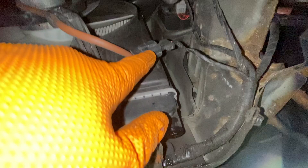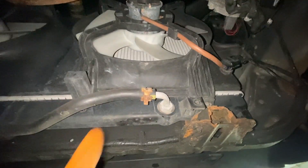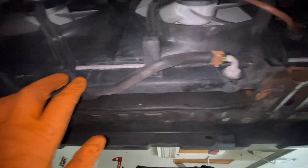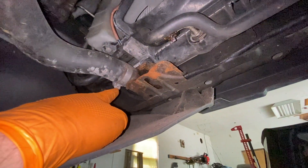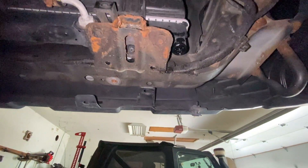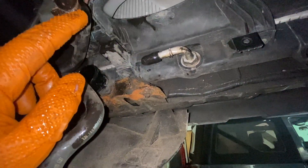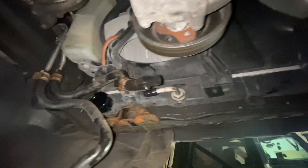After that, there's going to be a plug here for the fan — just disconnect this connector. You take that connector out, and over here you're going to have tranny lines, one there and one there. What you do is take the tranny line out and get a rubber plug to plug it so it doesn't spill out all over the place, and do the same thing with the one over there. After you've drained the coolant, take off the little radiator hose right here, and there's another plug over there — take that one out. Don't forget the electrical connector there and on the other side.